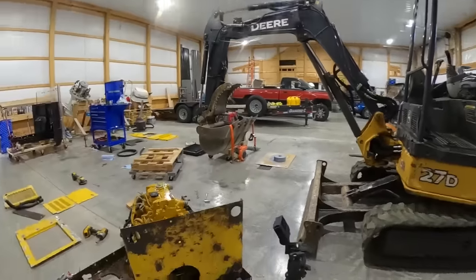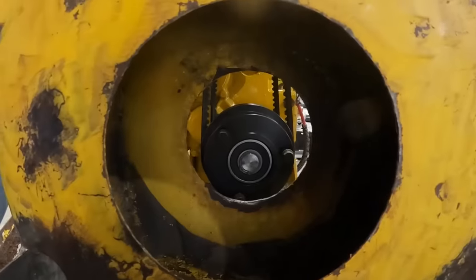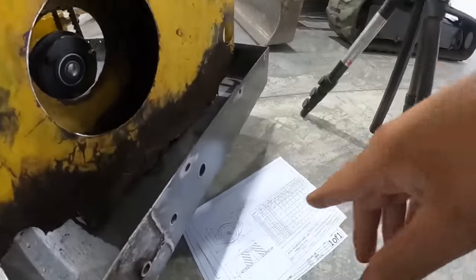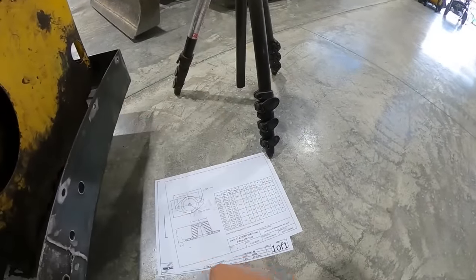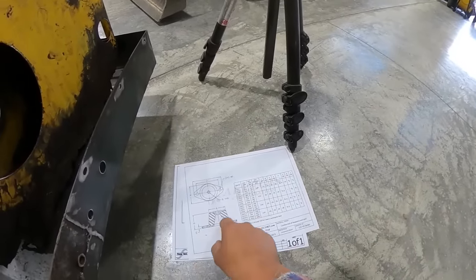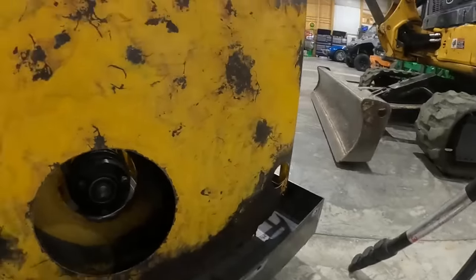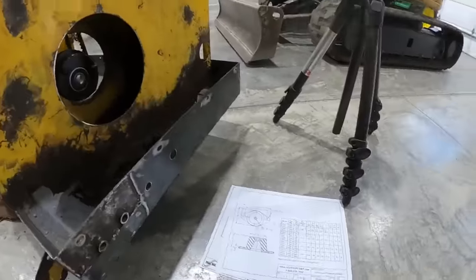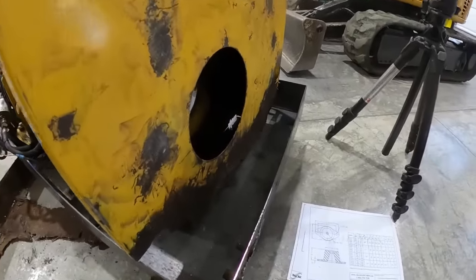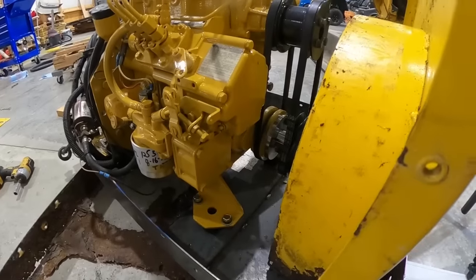So I'm trying to work through this a little bit. We are basically a half inch too low on this. And then when I went back and looked through the email, the lady said, when I asked her about engine mounts to begin with, because I was just going to replace them, they didn't have them, but she gave me a part number. And the part number then is 1¾". And these ones that are on here on the front are 1¼". So that would lift it up quite a bit, actually. So I'm thinking maybe that's what's wrong with this.